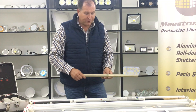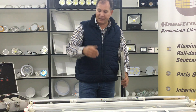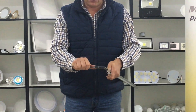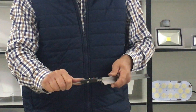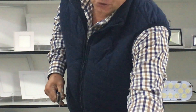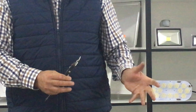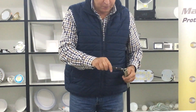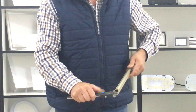We also have to look at thickness. If you take a regular tube light in the market and measure the thickness of the light, it is around less than one millimeter thick. There is not enough aluminum to do a proper job transferring all the heat from the diodes back to the body. If you look at the Jeric Holdings tube light, the measurement is 1.5mm thick.